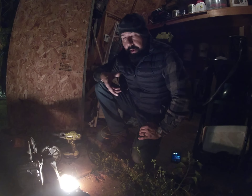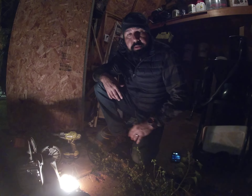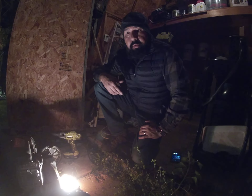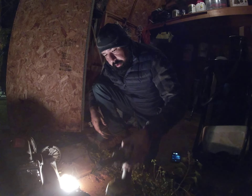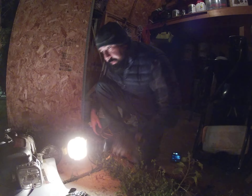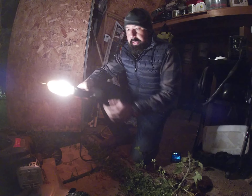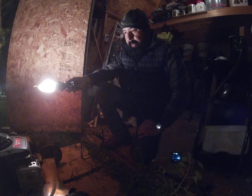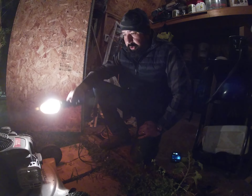It's carbureted, so I thought maybe heating up the carburetor would help out, because that's an old trick they used. You don't want to use fire obviously, so the best thing to do is use a light bulb — that's the safest way. It's still going to be hot so you want to be careful since you're going to be right up against the carburetor.